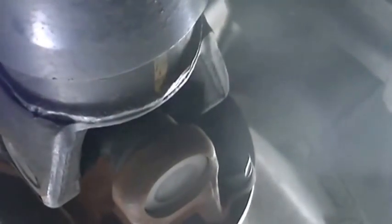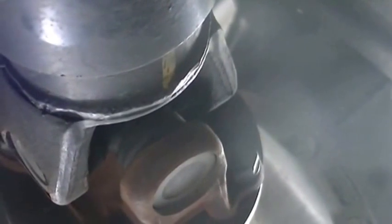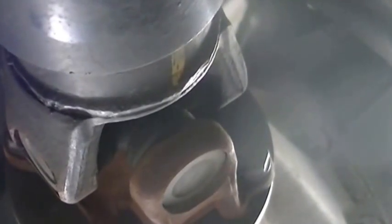Once I take it off, I'll probably put on some vice grips to hold it and shake it and see which area is shaking, the rear, which is this one, or the front. That means the universal joints, the universal bearings, have to be replaced. So I'm going to replace it. I'm going to take it off now and check it out. Stand by.